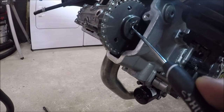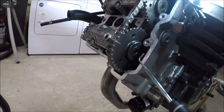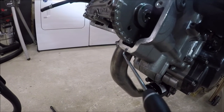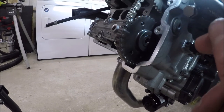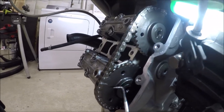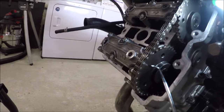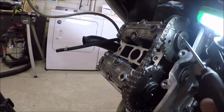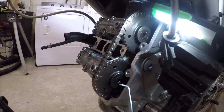There's these little markings here. We've got a B here and an A here, probably to differentiate between which cam is which. This is the intake. This is the exhaust. There's a couple of important markings here. The most important being this two and the three. I can see that there is a 1F that is pointing flush with the surface here. There's this two here on the exhaust and a three here on the intake. I've put some silver sharpie on those two. But there should be, when we put this thing back in, 16 pins between the two of them. It'll be important that we get those in the exact same spot so we don't mess with the timing of the engine.